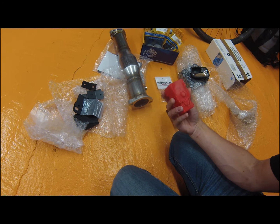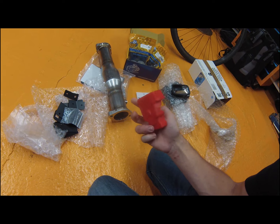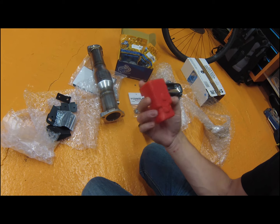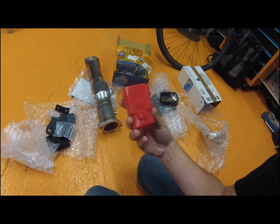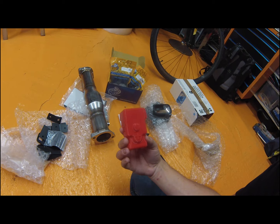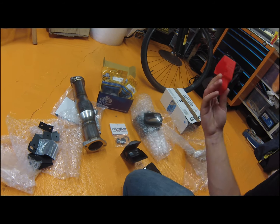Firstly, one of the things I did, the car I had didn't have a positive terminal. So this is a 3D printed one. Now this was just a first trial. I've actually got the real one on the car. There's still a few modifications I want to make to the design, because after it got incredibly hot on the drive out, it warped slightly. It still holds in place on the terminal, but I want to modify it again, so hopefully the next one will be correct. So that's the first thing.